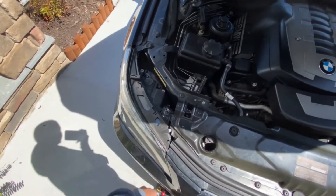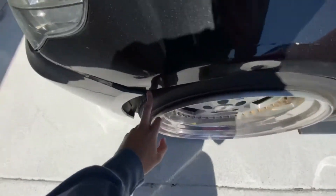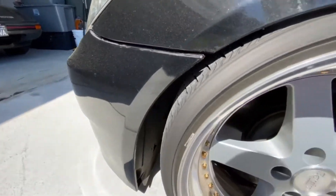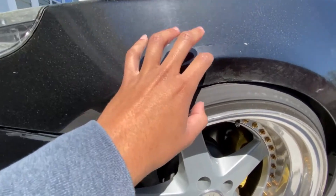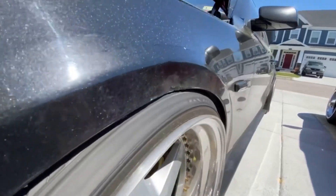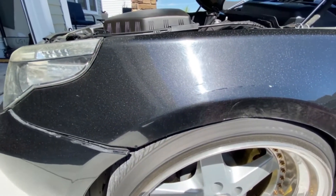I think I gotta remove my front headlights. I think I might have to remove my wheels because there are some clips right here running all along, and some 10mm bolts, so I might have to take off the tire. I don't know yet. I don't know if I should get a new fender or just get it rolled again. The tire grabbed it and sucked it in and cracked the fender right here — I forgot to heat up the fender and cracked it trying to fix it. But we're focusing on the bumper today.